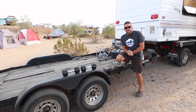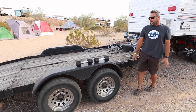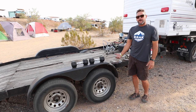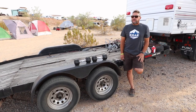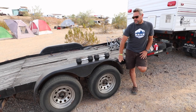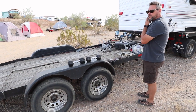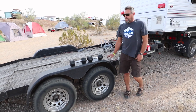This is our 16-foot dovetail trailer — it's been super handy because it's lightweight. We were able to flip the axles over and get a little more height so we can go into the backcountry with the Samurai still on it. We chose the Samurai because it's 2,100 pounds, there's nothing better to tow around, it gets great mileage, all the windows roll up, the heater comes on, and everybody can fit inside. The trailer has double-axle brakes and I can drive the Samurai right off without any ramps.